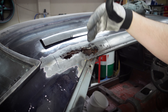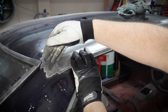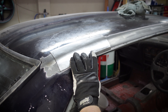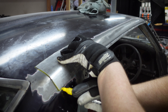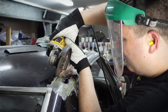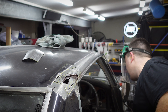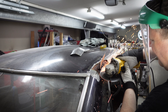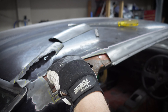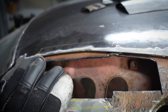In order to shape the compound curve here, I'm going to use our new tool, the planishing hammer. This is the beast in question — it is a Metal Master PPH 5-1 planishing hammer, it was about 350 bucks. I'm not affiliated with them in any way. It basically looks like a pretty serious piece of equipment. The basics of it are you have a pneumatic air hammer and an anvil, and it strikes at around 900 to 1400 blows per minute depending on your air pressure. There's a big steel frame with enough throat capacity to take on larger pieces of work, and it's foot pedal operated so you can keep both hands on your piece while working it.